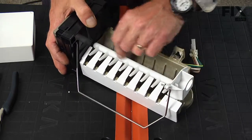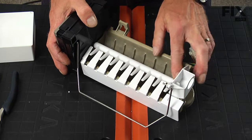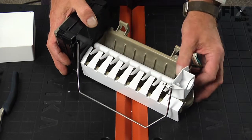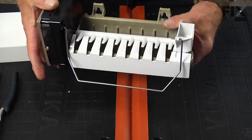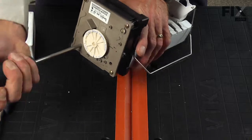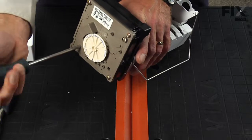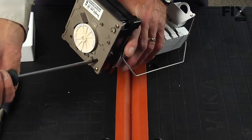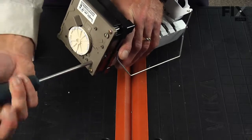We need to do that because this shaft through here fits onto that bearing and needs to be able to be pulled forward, and to do that we need to pull the ice maker head off of it. I'll begin by taking those two screws out — it's not necessary to pull them right out of the head, as long as they're completely unthreaded and loose, that's all that matters.